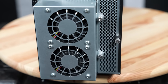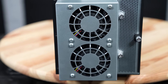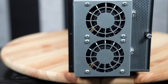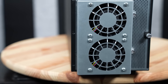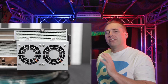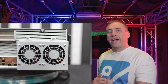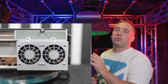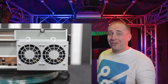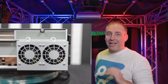The other big feature on the rear of the system is that you can tell this is set up for GPUs. We have two large fan modules at the back of the chassis that cover up the GPUs. You might wonder why you'd want two big fans there blocking display outputs, but this is really designed for compute accelerators — things like the NVIDIA A100, or FPGAs. You don't need display ports for those kinds of accelerators; instead, you need airflow because they have passive heatsinks. These fans are removable, but since we originally tested with NVIDIA A100s, we kept them in place to properly cool those extraordinarily expensive cards.